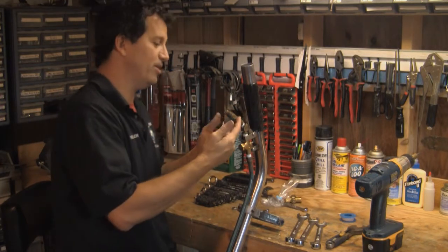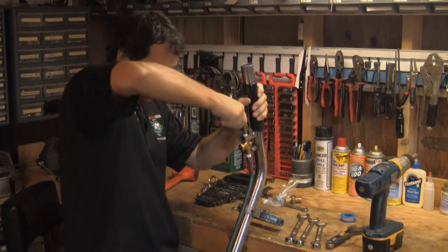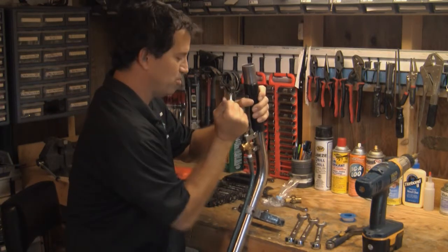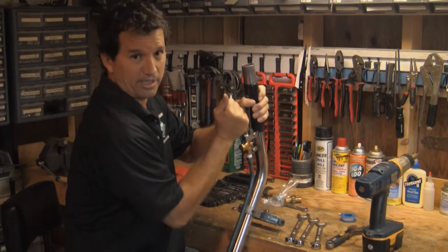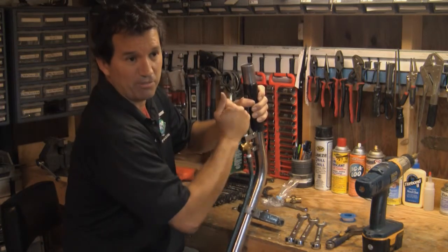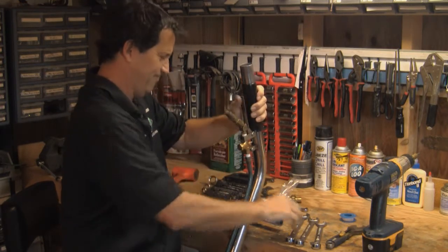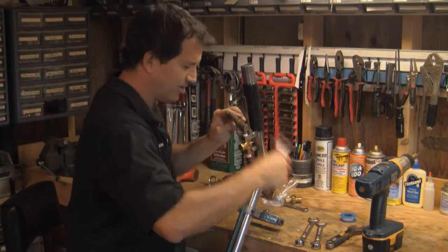While you've got it apart, you might want to go ahead and take apart the filter too and clean that while you've got it open. I recommend cleaning it at least once a week. That filter catches a lot of debris and keeps your jets from getting clogged. Some people don't even know it's there — I've had people bring me a wand that's completely caked, and their water pressure is nearly nothing. It's amazing they're able to even clean.